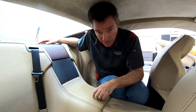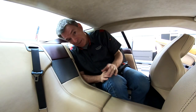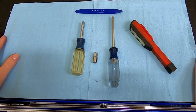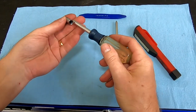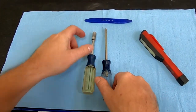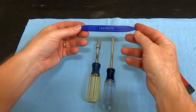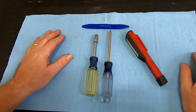There are a bunch of reasons you might have this out — you might want to be refinishing the leather. Taking it out is just a methodical process. You need a couple of basic tools and you might need a couple of parts. We only need a few simple tools to remove the rear center console: a 7mm socket on a quarter-inch drive used with a nut driver, a number two Phillips screwdriver, a non-marring small pry tool to get underneath the fir tree clips, and a shop light in case you're having trouble seeing something.